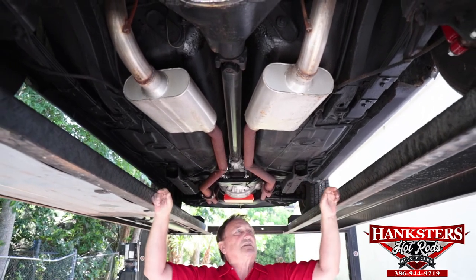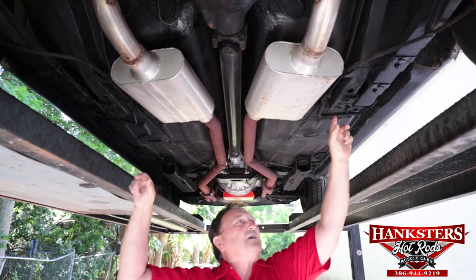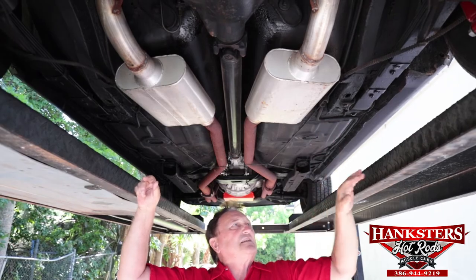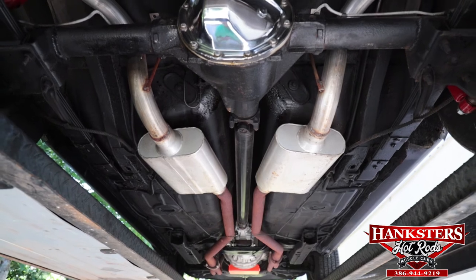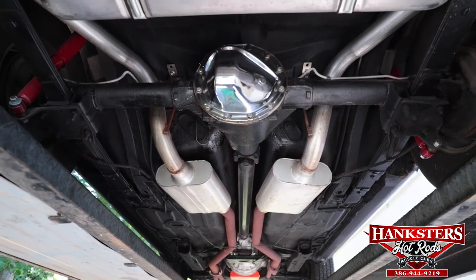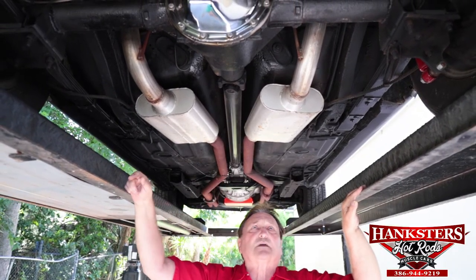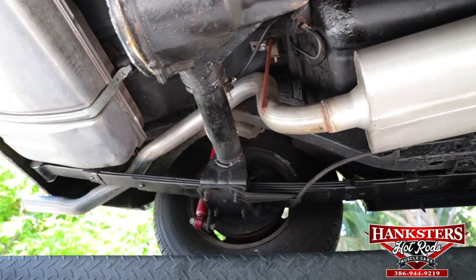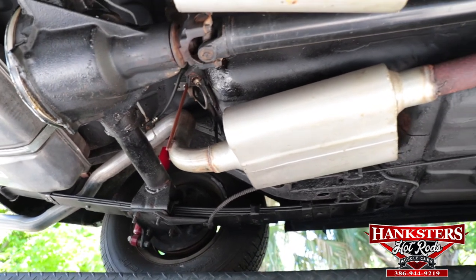Torque boxes are really nice on this particular car. No dents or marks. There is one little one here from being jacked up through the years. You can't see it, but it is there. A little indentation from the edge of the jack. Multi-leaf rear spring suspension. Brand new shocks in the rear. Drums, as I stated, all around on this particular vehicle. Does have a 12-bolt posi rear in it. Heavy-duty GM rear. 2 1/8 pipes terminating out the back. The way it would have been on a Z28, really.